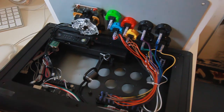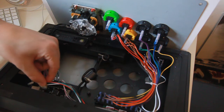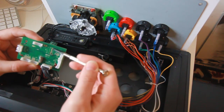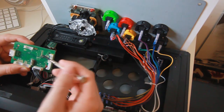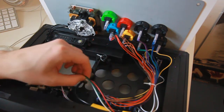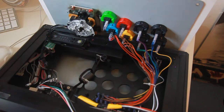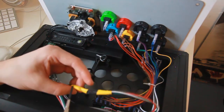You can use the onboard jack here to wire a USB cable via a hole that you would have to drill into your Xbox, PlayStation or PC. However, as I said, the cable is supplied and sits nicely onto a quick-connect plug onto the new board. On the old board, the wires are soldered into five parts here. To make life easy, there are two black ones — one is a lot thicker than the other — and there's a white, red and green. You only need the four thin wires: the thin black, white, red and green. Cut them off the old board, cut back the sheath. This is where I used the soldering — I soldered the old and new cables, green matching green, white matching white and so on. I wrapped some heat shrink round first and heated it with a hairdryer afterwards for stability, plus a bit of insulation tape for good measure.